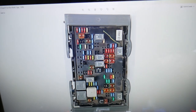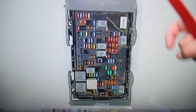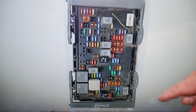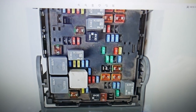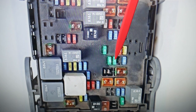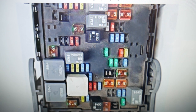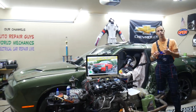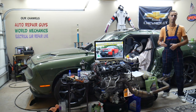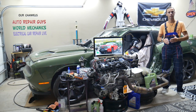So if you guys have no sound, which two fuses do you need to check? If you come towards that section right here on the front driver's side of that fuse box, you're going to notice fuse number 41 — that's for the sound amplifier. If that fuse is blown, you'll get no sound. There is another fuse you need to check as well: fuse number 42, and we're talking about this 15 amp fuse. Other things that can cause no sound: it could be a bad sound amplifier, or an unplugged wire from the radio unit or the sound amplifier. We see that quite often if people replace things and didn't push them all the way to click and make sure they're secured. Hopefully this video will be helpful. If you have any questions, let us know, and see you guys next time.